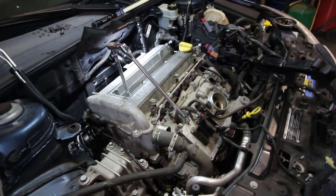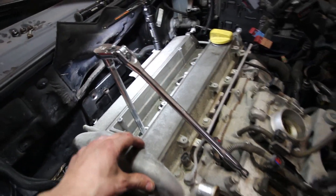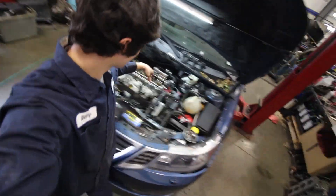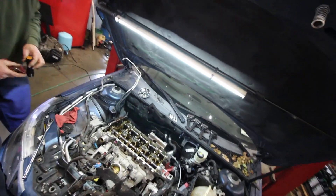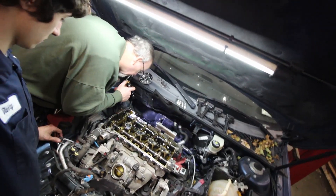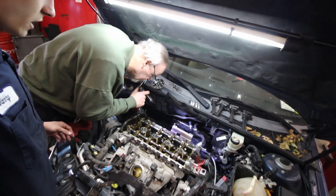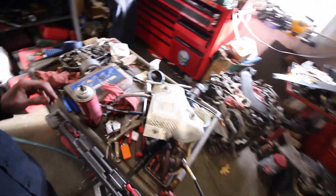Alright, I've gotten the turbo off. Turbo's off, intake's off. Taking these out now, then I'll take the valve cover off. Super close - couple more things to take off. There's a metal bracket right here I'm going to take off. That comes off, yeah. I'm almost done. You're just leaving the manifold right on the head. Got a little bit of a mess over here.